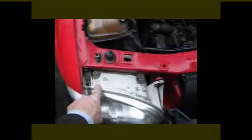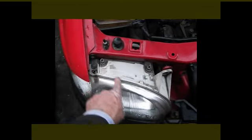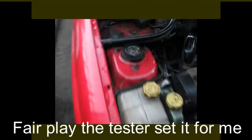The back doors — they're not immaculate, but with a coat of polish, when it rains now the rain won't soak into the paint, it'll all run off. Headlight aim was one of the things — I lined up against the garage door, brought the beam down and in, and got it roughly right. Fair play to the MOT tester — I told him I'd done it against the barn door and he sorted it for me. That's where the wax oil goes — under the bat rig. It's covered in wax oil every year. You can't see that when I'm going down the road.